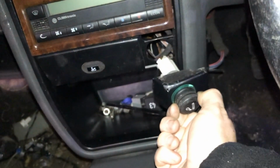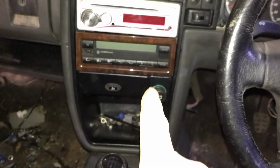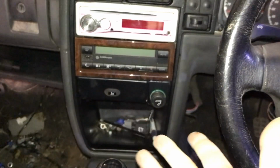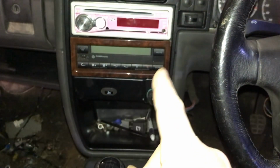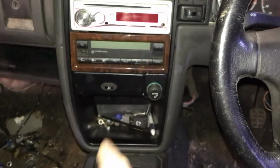This piece here, I can actually pull it out. It's fiberglass. I just made it up, and it'll be glued in there permanently. The reason why I made it in fiberglass is because I could not find one anywhere. I did look, there was none available, so I just made up one. I wasn't doing anything on a Sunday and just decided, right, I'll just make a negative. I got my own one out of the other car, made a negative mold, and then pulled a positive mold off it. So that's now in.